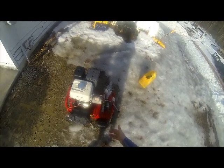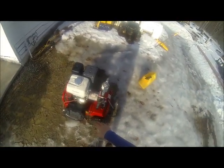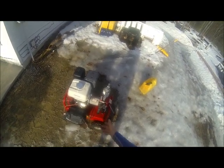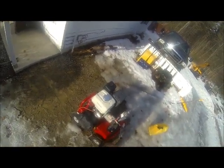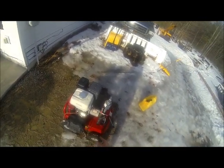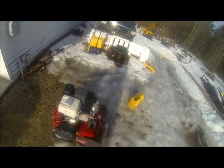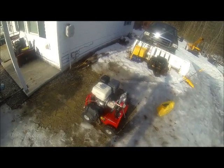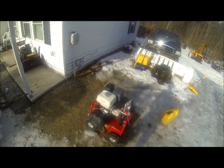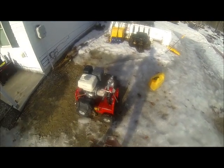Basically, that's the unit. There's a filter on here for filtering the hydraulic fluid. This has automatic transmission fluid in it — there are a couple of different fluids you can use, but the reason we chose ATF is that if we hook it up to a truck, a lot of the older trucks used transmission fluid for their power steering too. So you can run the winch off the power steering, and we can set it up that way depending on the truck.